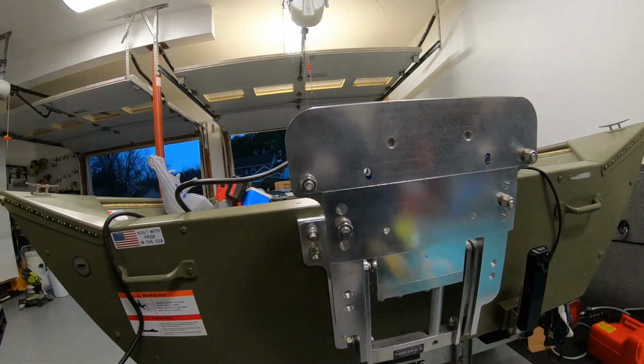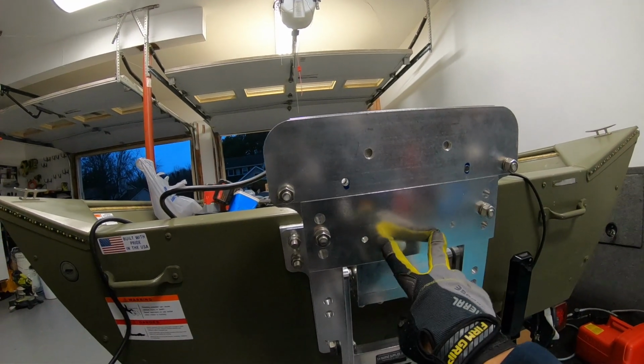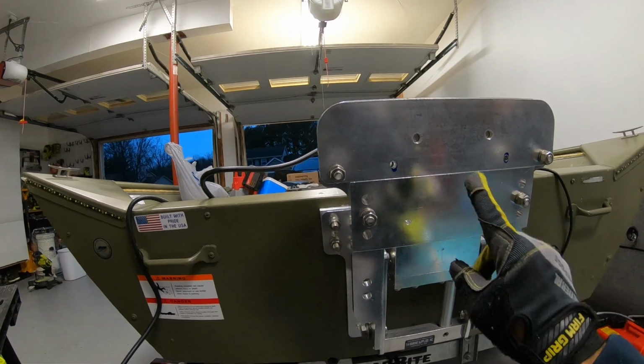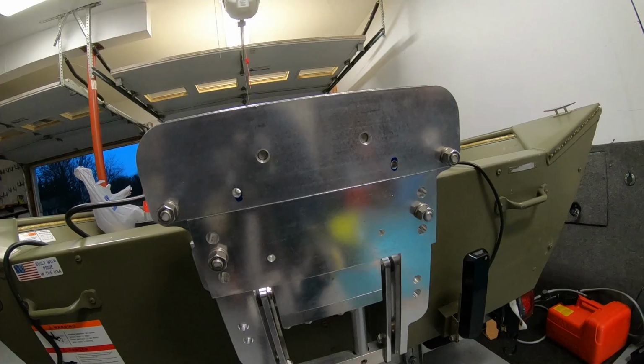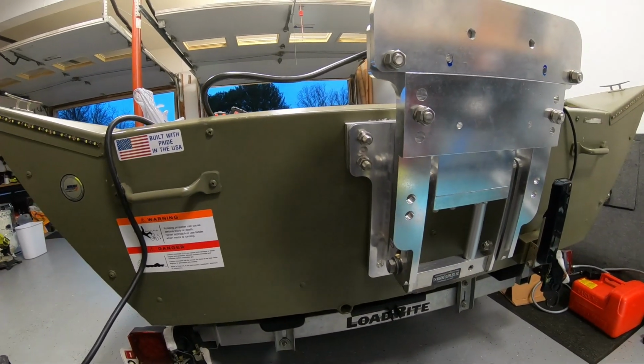So I've taken the motor off. I've gotten all 4 holes drilled out, 2 for ePropulsion, 2 for the Mercury, and I'll have to get the right size 5/16 bolts for that. Both sizes I bought, one is too short, one is too long. I'll pick up the right bolts from the hardware store. So I've got really 2 steps left on this jack plate install.